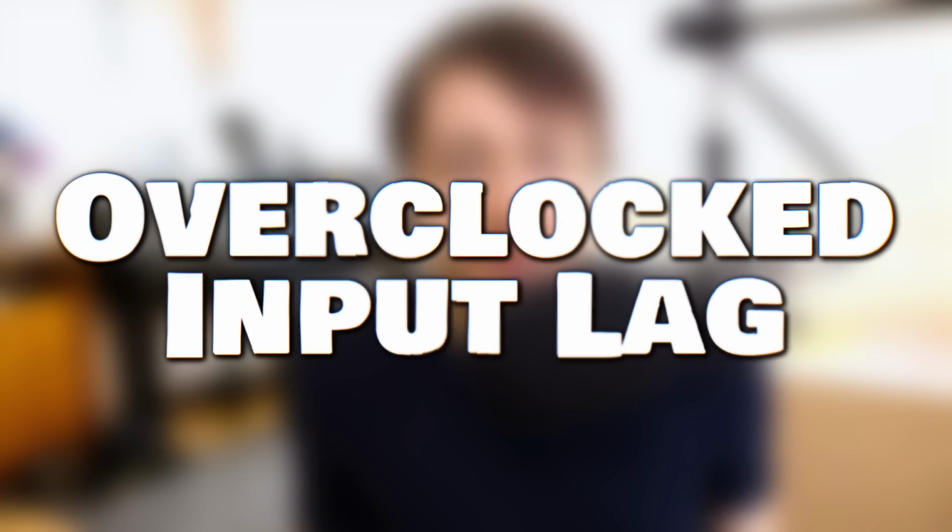Okay, enough about that. Can we mitigate the input lag somewhat? Yes, by overclocking the polling rate. Watch the DS4 overclock video for instructions. All controllers do benefit, but by significantly different amounts. The Xbox controllers are rate limited as discussed in the previous section.